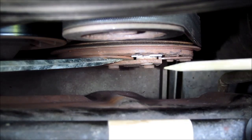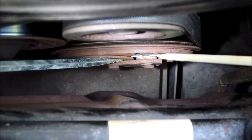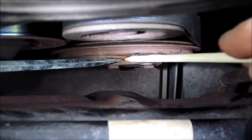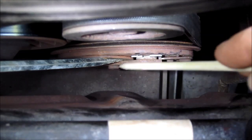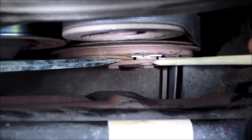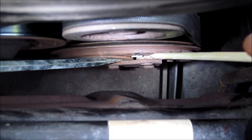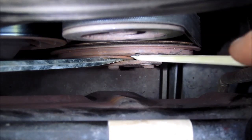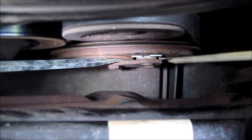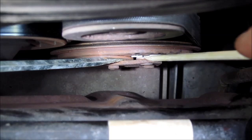You can see the first of the shims installed — this is made from one of those bread clips shown earlier. You can't see the gap now because we've forced it all the way closed by jamming the screwdriver in here to create the space to insert the bread clip. We're going to put some adhesive on that so it doesn't come flying out when the engine is at speed, and then we will put two more on the other two spring arms.